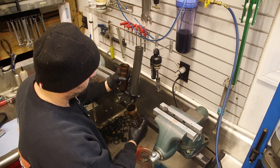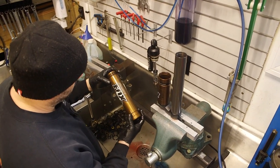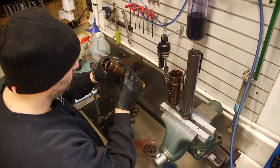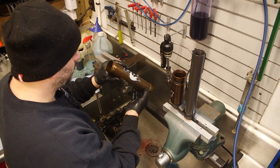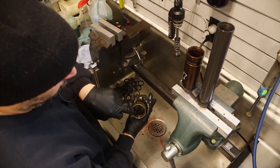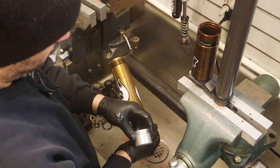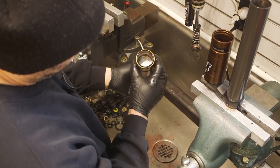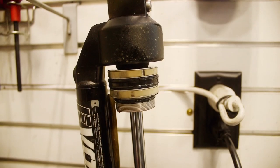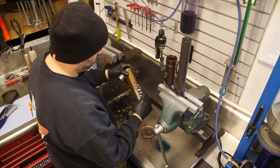The air sleeve just slides right off. For initial inspection we're going to look down inside and a lot of times you'll be able to see if there's any dents. I also use this tool - which I made but Fox sells - it's the tool to install the bushing inside. I slide it down through the tube because if there's any dents it'll get hung up. There are no dents there. Another issue could be debris inside - rock, dirt - and that could have been what damaged those wipers.